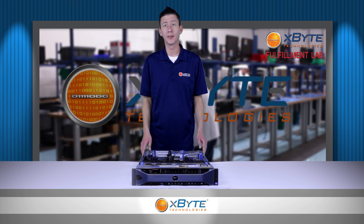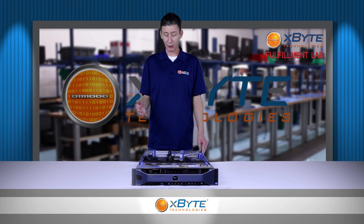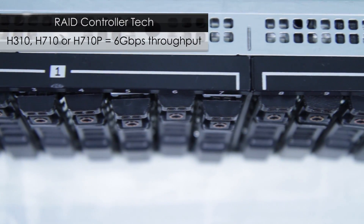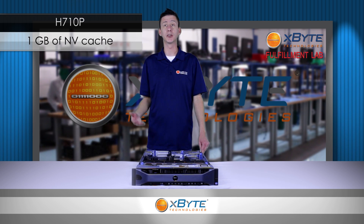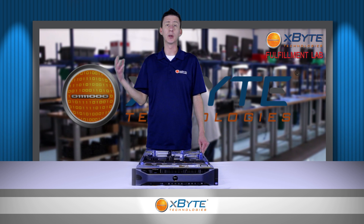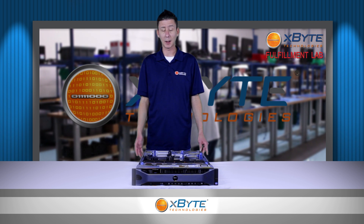With your backplane option, you can either have eight or sixteen 2.5-inch bays, which will give you up to 19.2 terabytes of storage. To control those drives, it uses Dell's H310, H710, or H710P PERC controller, with the H710P having one gigabyte of non-volatile cache. In the event of a power cycle, the data in the cache will be written to flash memory where it can be stored for up to 10 years. It also includes six gigabit per second throughput that today's applications need.